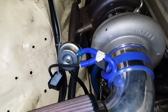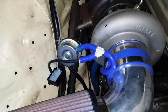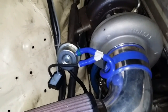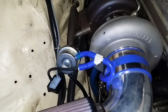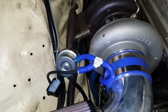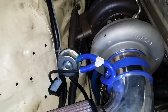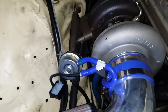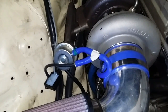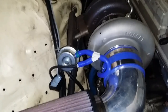I'm very pleased with the starting point — I can really get on it and it's working fine. Third to fourth is a bit sloppy; I'm probably going to hook up that external speed sensor again. My linkage right now requires me to pull out the injection pump, rotate it a few degrees, and put it back in because the linkage is hitting the block — so I can't open it all the way. But in terms of the transmission, I'm very happy with it.